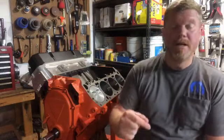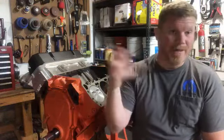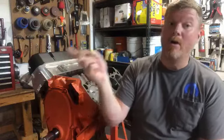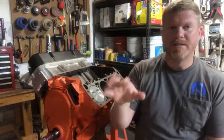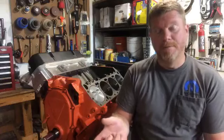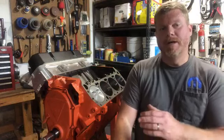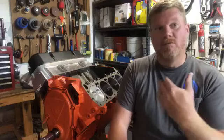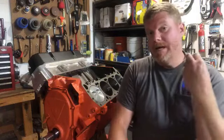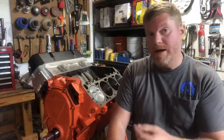Spark plugs actually change their hotness. They call it hot, you know, how hot is your spark plug or how cold is your spark plug. That's something a lot of guys talk about, how hot it is or how cold it is. In a high performance engine, you want it a little bit colder. The reason you want a slightly colder spark plug is because you're running on a superior gasoline, and so you don't need so much of a spark to ignite it. If it's hotter, it's going to pre-ignite that gasoline. It's going to pre-ignite your mixture.